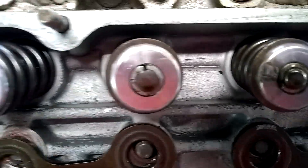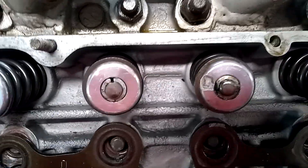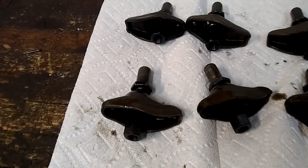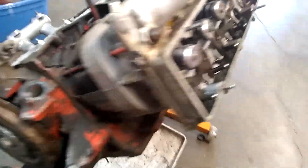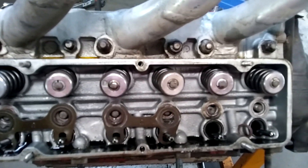I'm sure it was causing some kind of problem. If you look on this particular area — do you see how there's a wear mark there? That means the rocker was actually running on these aluminum valve retainers. Typical sand rail stuff. Over here, he did spend the money on some grooved rocker balls — these have the grooves to them — and he does have stops that are theoretically not going to back off under high RPM. As I work through this engine, I'm going to try to highlight any of the mistakes that I see, and hopefully we as Corvair enthusiasts can stay away from that type of practice.